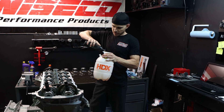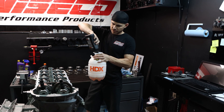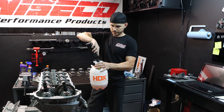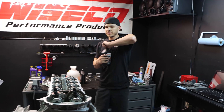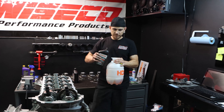We've got at least three quarters of a quart in there. I'm going to put two quarts in here, and then I'm going to let Patrick take this with him hooked up just like this so once they get the engine in the car they can re-prime it. I'd prefer you prime it like this within 30 or 40 minutes of you firing it back up.